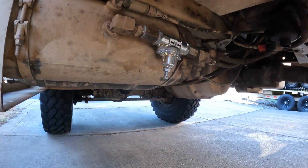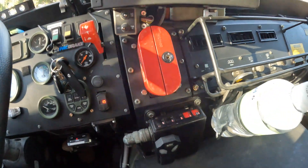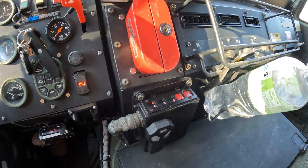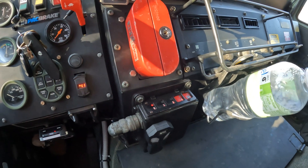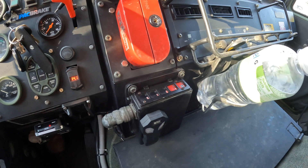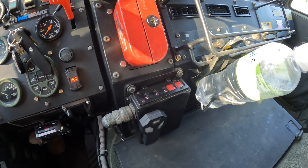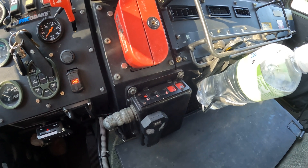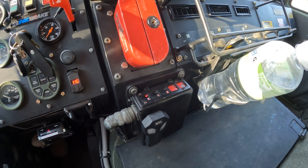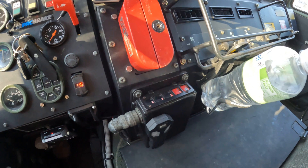We're going to figure this out — I'm going to start the truck up, let it air up, and then we'll go from there. We just got past 90 psi and we're working our way up. If the system is working, the CTIS will try to engage, check the pressure, and then the highway light should go solid. That little pressure protection valve allows air to go through at a certain set point — I believe the stock set point is 85 psi if I remember right. The beauty of that valve is it's adjustable; the other ones on the market aren't adjustable like the OEM one is, which is why I wanted to try and find the original one. And there it goes.